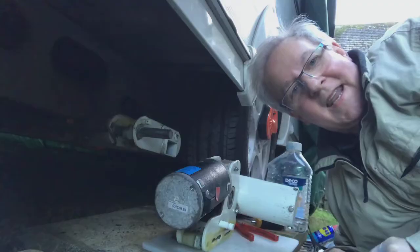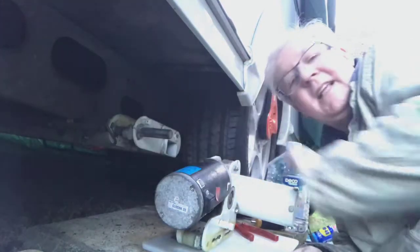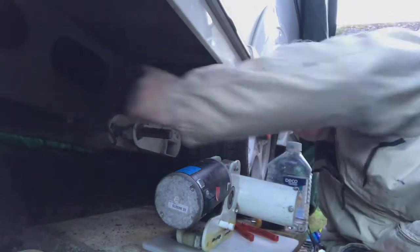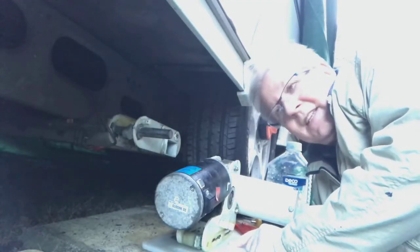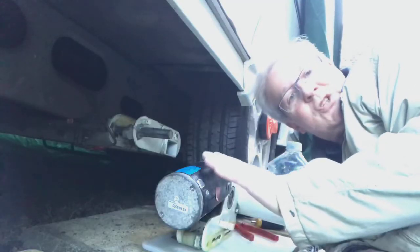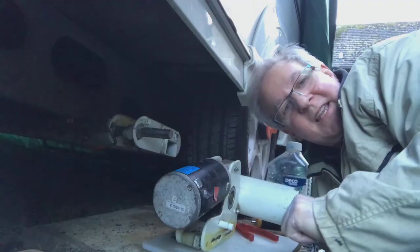Hi, so we're getting towards the end now. I put some spray inside this joint at the back, but basically I've cleaned up the whole area and put lots of grease on the interior two sides, two faces that face inwards, that rub against the two outsides of the plates on the motor assembly. So that's all nicely lubed up and ready to take the motor mover itself. One tip is, if it will reach, it's probably worth connecting the back electrical connector first, because it's really tricky to get to and to do it properly once it's in situ.